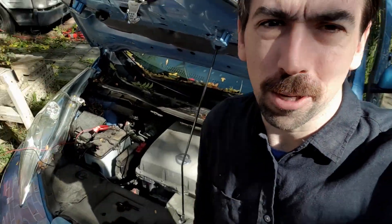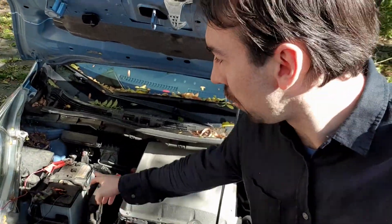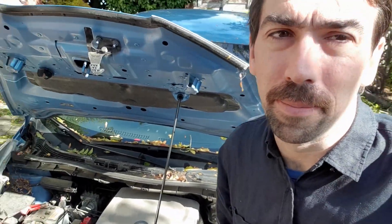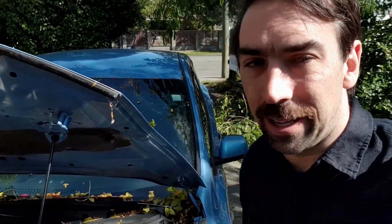All you need to do in this situation - don't panic - just pop the bonnet. What you can do is take the battery out and charge it in place, or you can just jump start it. I'm going to go for the easier option, which is charge in place. I've disconnected the positive terminal to the car just because it was doing that beeping - sometimes it'll do a clicking noise. I've also had issues previously with the lights being stuck on when the battery's been really low. If you just disconnect the 12 volt battery, it'll cut all of that out and you can charge the battery without any issues. Then once the battery's fully charged, you can reconnect everything and it should behave as normal.